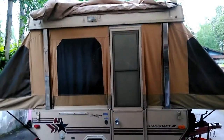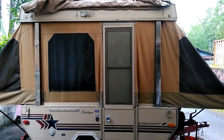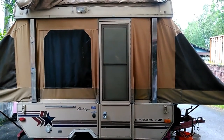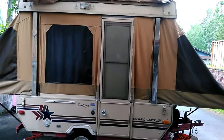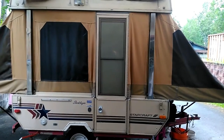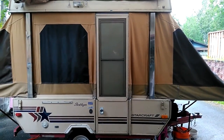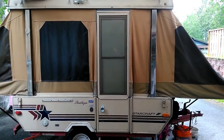After quite a few adjustments and moving the roof up and down, I got each corner approximately 49 inches and the door fits a lot more square now. One thing I learned is that after you adjust those turnbuckles on the cables underneath, you need to take the roof all the way down to the stowed position and then bring it all the way back up — that kind of evens out the cable tension. I was just making my adjustments with those 42-inch blocks, and then when I put it all the way down and all the way up, the corner that was the highest before was the lowest. So I probably could have saved myself some time by lowering it all the way and raising it all the way between adjustments.